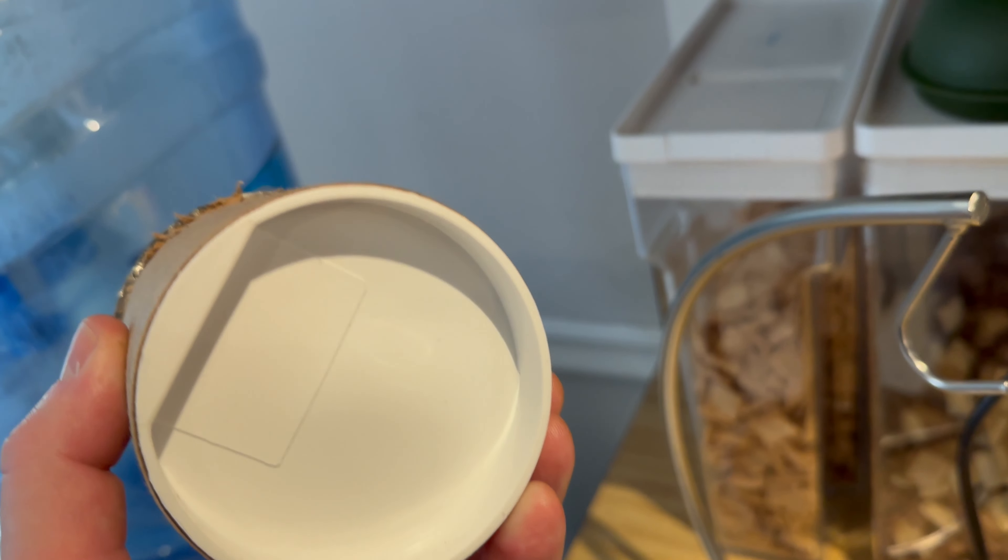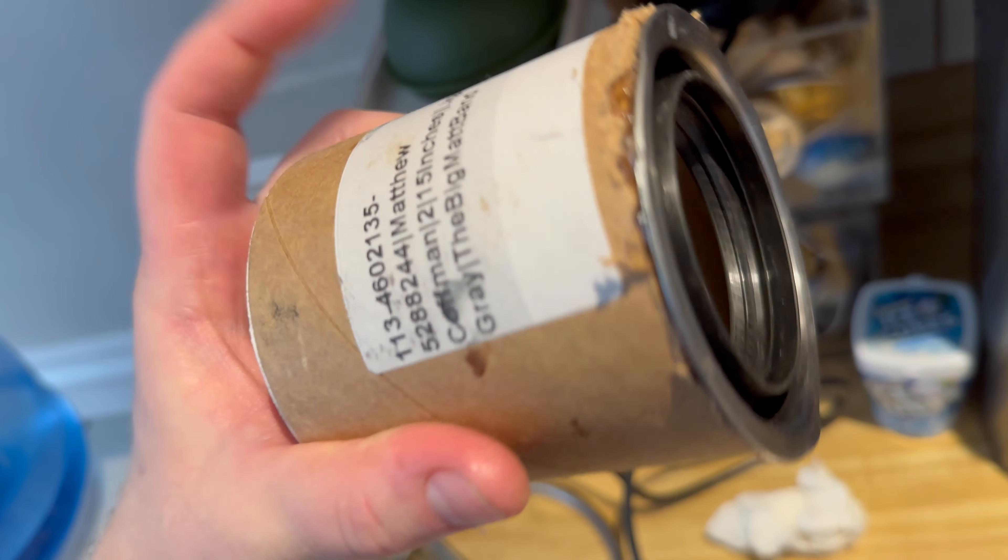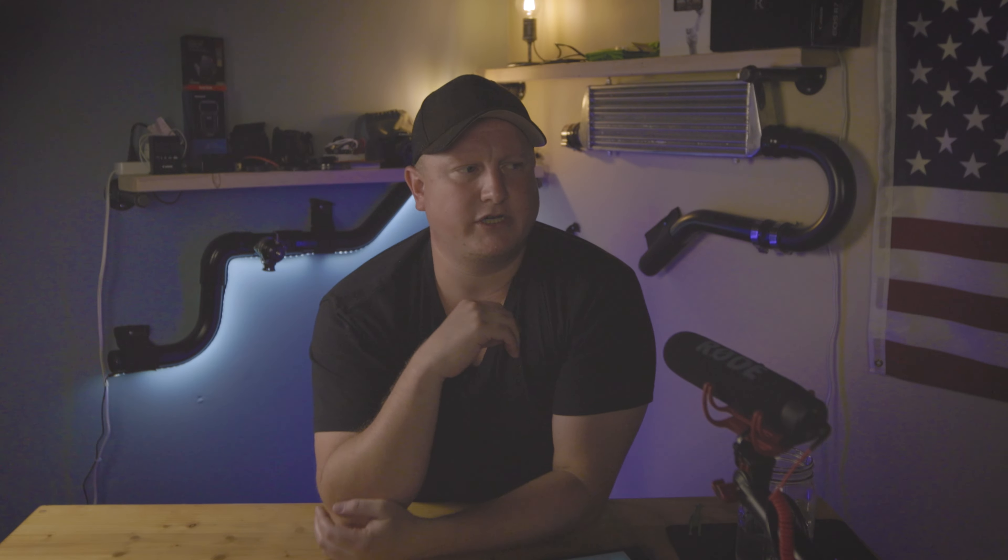This time around I did a proper clean-up job on the whole rear end. I really ground everything down on the housing where the new seal had to go, then went around it with a flapper wheel to smooth it out. I made my own makeshift level to check for dips on that circular mounting surface. Then I took seal number two as a diameter guide and created my own little tool to install the third seal flush — and it worked out beautifully.